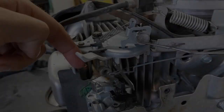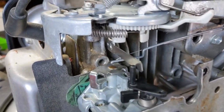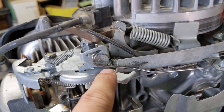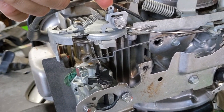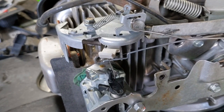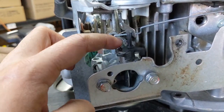I'll reconnect my lever — bolts are tight — so I should be able to engage the choke. If there's too much tension down here it's going to put too much tension on this arm, which is going to put too much tension on that piece and grind the plastic like the issue we were having. Now that this rod has been bent, if I pull on my lever up top it should release and hopefully it won't catch anymore. It is still catching just a little bit, and the return is super slow — I'm not touching anything, just letting it go on its own.